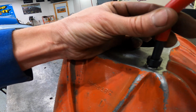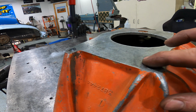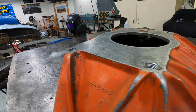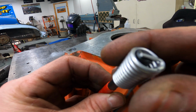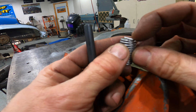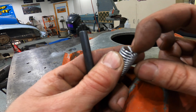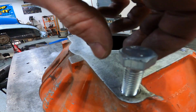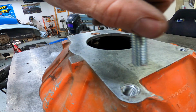But now that there's just a little bit sticking out, I can just take the washer off to make up the difference. And I screw that until the helicoil is flush. Now eventually you need to go back with the break off tool here and break off this tab that's sticking down. So you'll put this in there and you'll hammer that, and it's kind of hard to see with this, but there's this little divot right here, and that's the weak point in the helicoil, and so that will snap off. And then you can see the original bolt here goes in real nicely, and that'll hold all the foot-pounds of torque that you need to throw at it to connect the transmission to the bell housing.